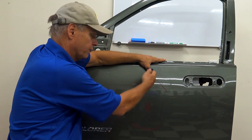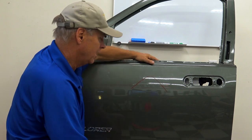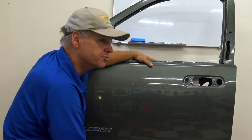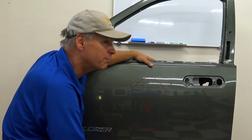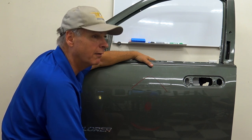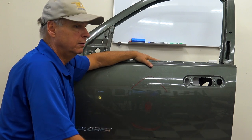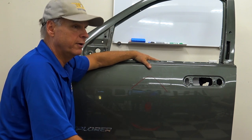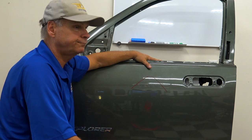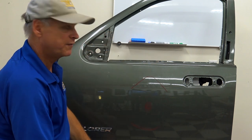That's right. So after my metal popped, because the crown moved back into the dent and the dent popped out, I look at my dent, and I didn't get 50, 60, 70% if I'm lucky. I got like 85, maybe even 90% of it popping out. And so using that tension, it's going to leave you with very little in the outfield. I'm going to get to a much faster finish now.